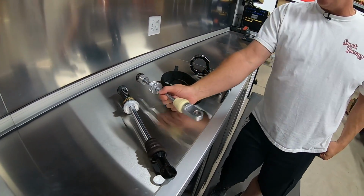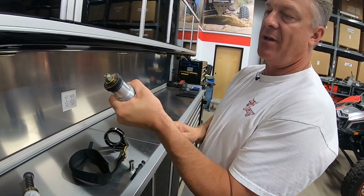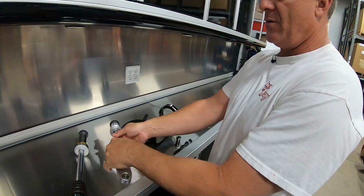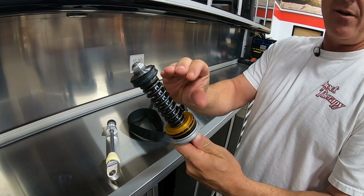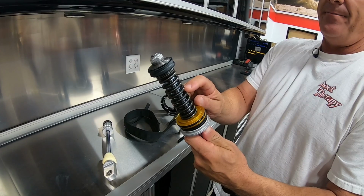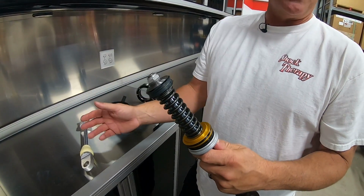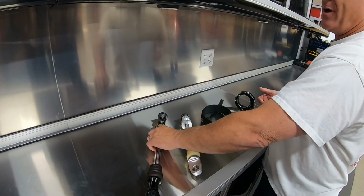Yeah, I would say that the Walkers are louder because the extension stop, this hydraulic stop, it's definitely aluminum on aluminum. When you get into the Foxes, it has to compress this whole spring before it gets metal to metal. So it won't make as much clunk as the Walkers do right away. You have to put a lot heavier system on this to have a problem. But they all pretty much do.